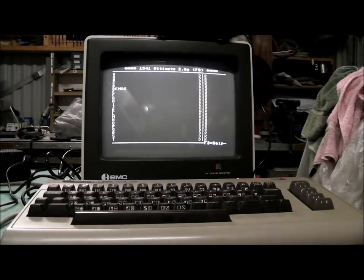This time around we've got a computer monitor at Oldburn. The brand is BMC and the model number is BM-4040P. It's a 14-inch colour monitor and right now it's connected to a Commodore 64. It's basically hooked up via S-Video — technically it's probably not S-Video because the colour line uses a little bit higher voltage, so technically it's not S-Video by specification, but purposefully it is actually really S-Video anyway.